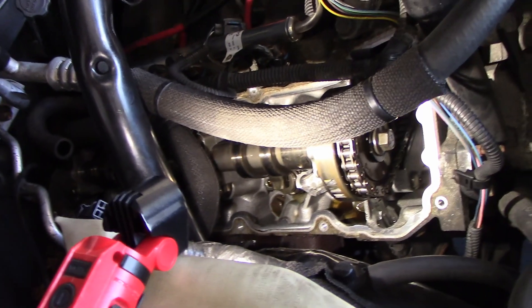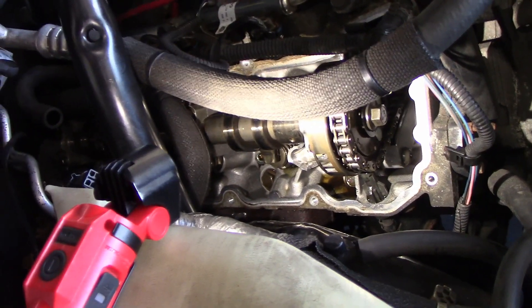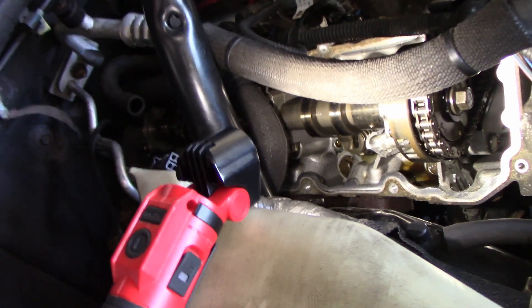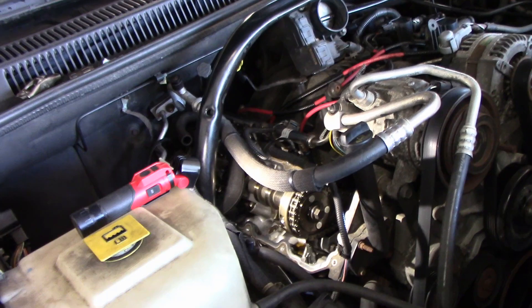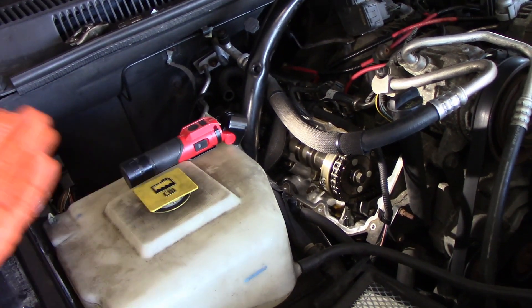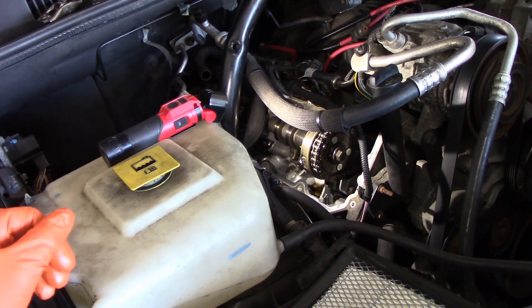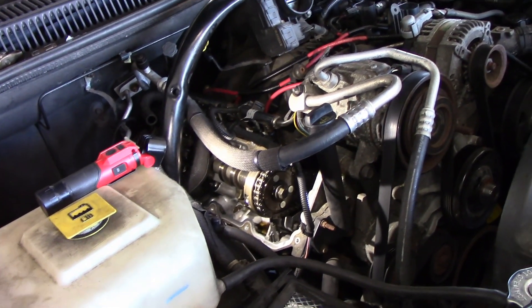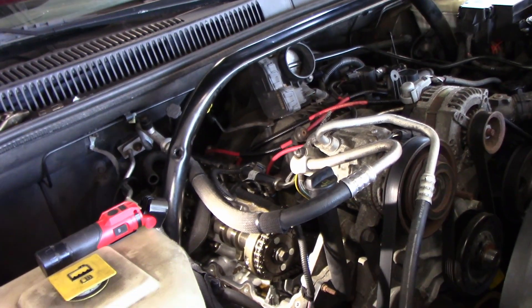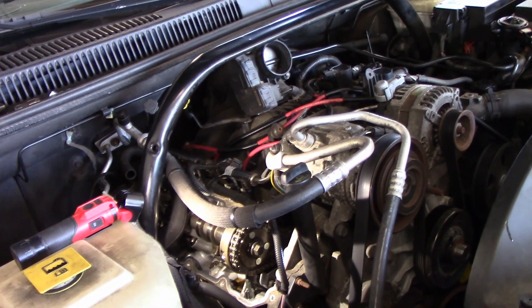So there you go. Using the scope, you can easily pinpoint where the issue is without even having to open up the engine or remove many parts — and boom. That's cylinder number two, and we got it diagnosed. I hope people watching can understand and gain something from this — ask questions, why did it have a hole in the valve cover? Just be methodical and logical before throwing parts at things. Maybe even ask technicians why they think something should be replaced, and did it check bad before we replace something?